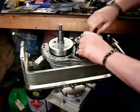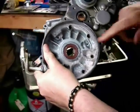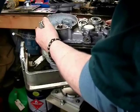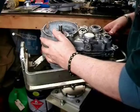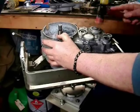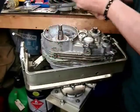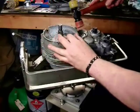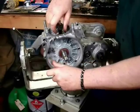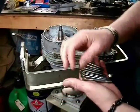With the gasket stuck to the clean cases, my bearing and seal are lubricated and we put this together very carefully so we don't nick the crank seal. Line everything up, then some wiggling — the only thing that keeps this from falling perfectly in place is the two spring-loaded wheels on the shift drum causing the drum to cock just a little. So it takes some tapping, but it goes right together. Spin the crank, spin the gearbox — everything should be fine. Put all the bolts in and recheck everything for binding.